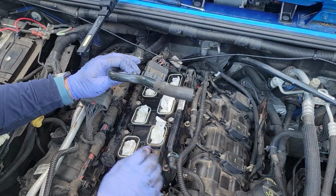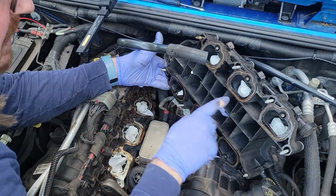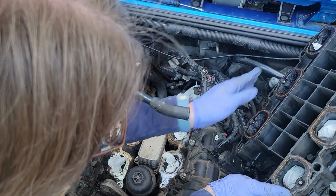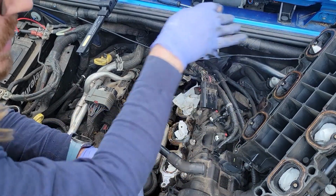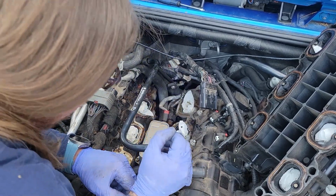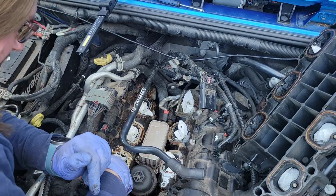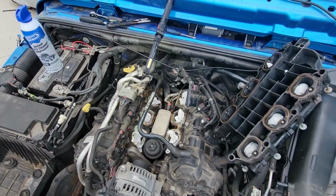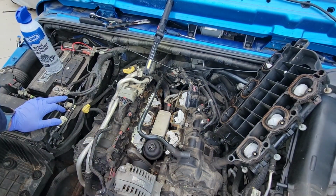Okay. The other thing that's connected is the fuel line. And as you're doing this, you've got to make sure you don't damage your fuel injectors that are right here. So don't be ginger or get pissed like I was. There's a lot of carbon buildup on these. What is that, the driver's side? Okay, so now we get the air hose and blow all this shit out of here and do what we can to clean this up a little bit. All right, so the lower intake is removed. Got the air hose out. I blew this out as much as I could.